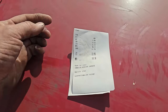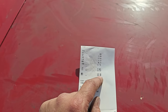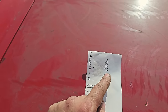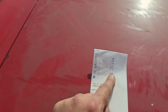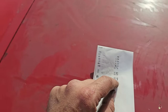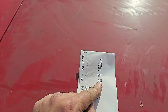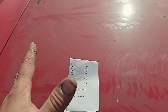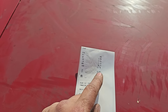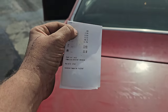First rip back out, spinning first and second, 1395 at 101, which is exactly what I thought we would run. But we can get this down. We're dropping some tire pressure right now, and I can be a little bit more gentle into two. We can pick up to 330, and I think we might catch. I'm gonna wait to shift in second. I didn't quite know where to shift. We found it in third. It's about 6400, 62 to 64. So I can ring it out a little bit. We might catch some more mile per hour and bring that ET down a little bit. But this is incredible. First slip in 40 some years.